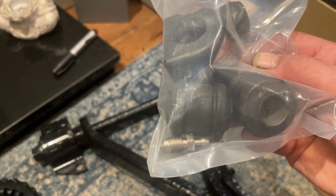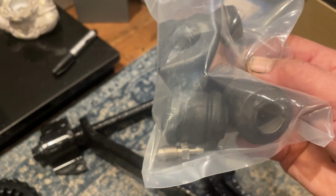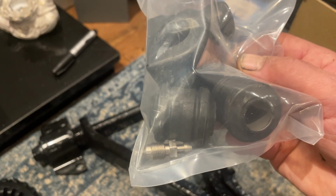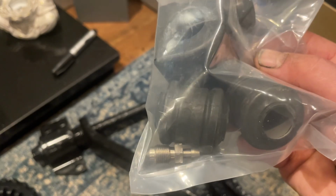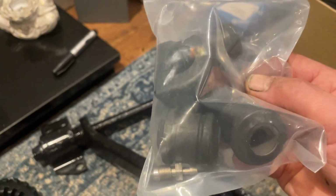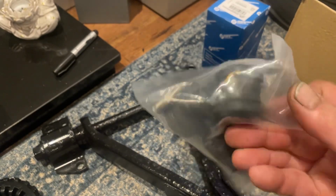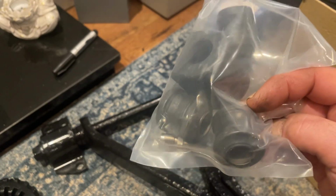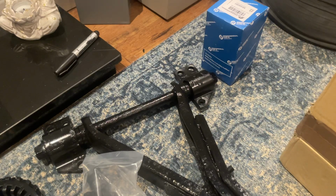When I get round to rebuilding my brake hub, that's the stainless steel M10 threaded bleed nipple. Again, stainless steel. Obviously, these things rot out, but M10 for the T16S and the Carlson. Obviously, mine's the Girling brakes and the handbrake works on the front wheel. So, obviously, you use your own investigation work on what's right for you. But I thought, yes, go for stainless steel, get that done. So that'll be most of the bushings. The upper and lower, what do they call it? Ball joints, they're fine.